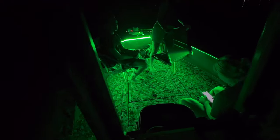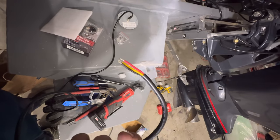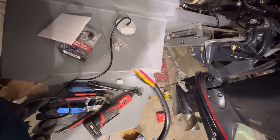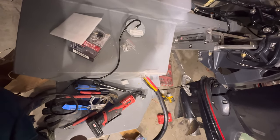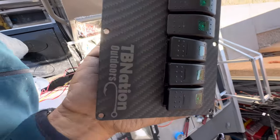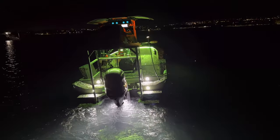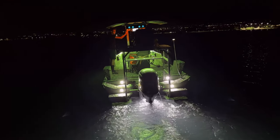To wire this, you have a black, red, and yellow wire. The black and red wire go traditionally — black to the ground and red to the load. The yellow wire goes to the switch, which is just a standard rocker switch like the ones on our TV Nation switch panels. So what are you waiting for? Get a pair of these and enjoy the most epic lights on the market with a lifetime warranty to back it. See you out there!